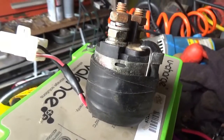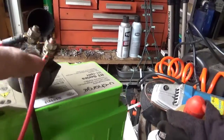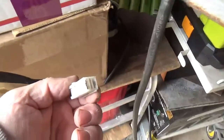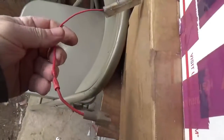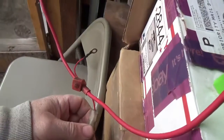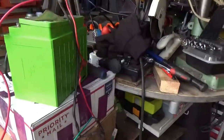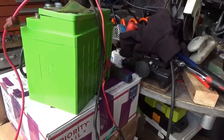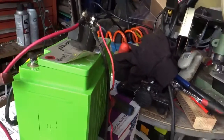Given what we've just said, I went through the wire harness and this is the starter side — you can see it goes right into the jack, so I just have to plug that into the starter. That side goes to ground and this side goes to the battery. I'm leaving this extra wire on here because I don't want to tear it apart, and honestly I may need it when I do some additional work. If you guys want to see it, I could do the voltage regulator side also, and then honestly what I should do is just clean up the entire mess and make a proper wire harness for it.